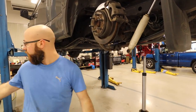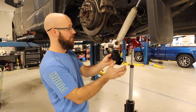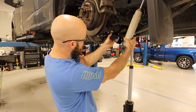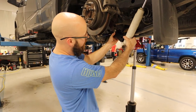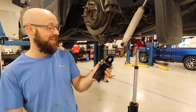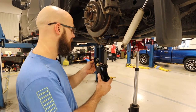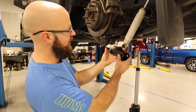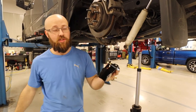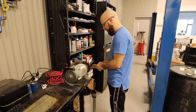I did look at the hardware here on this side — since the shock is on the back behind the axle, this fancy little bracket here is actually a shock extender to move the shock out of the way of the bag a little bit. That's what this thing is for. If I'd just read the instructions a bit more I would have figured that out, but it actually extends your shock location to help with the position of the shock relative to the bag.